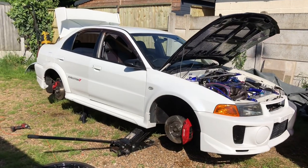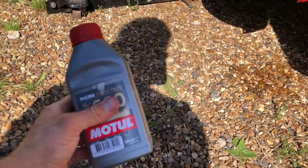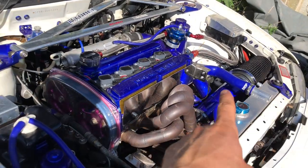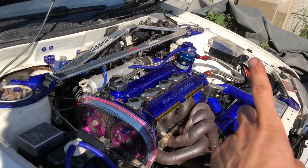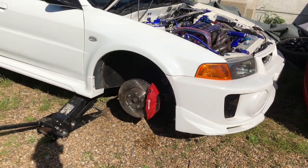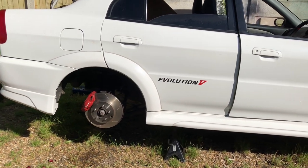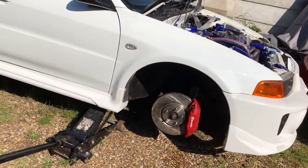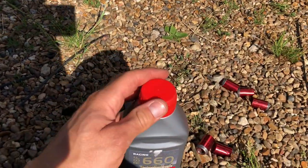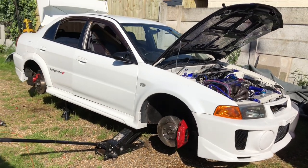It might sound extreme but I've taken all four wheels off and bled the brakes again to make sure we've got good Motul racing fluid through all the braking lines with no contamination between two different brake fluids. When I bled the clutch, which runs off the same master cylinder into the slave cylinder, the fluid was black, and what was coming out of the brake lines wasn't much better. So I went over it again using two litres of Motul fluid - I know it's definitely all the way through now. On old race fluid we used to have it blue so you could tell when fresh fluid came through, but European regulations say brake fluid can't be blue anymore, so you just have to wait until the black fluid clears.